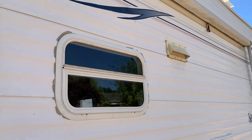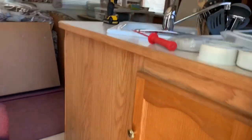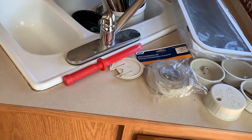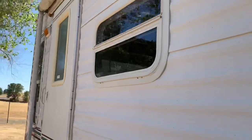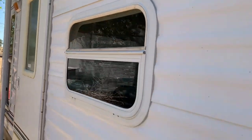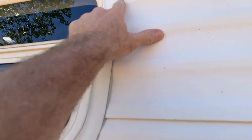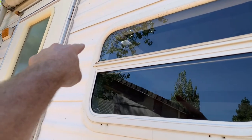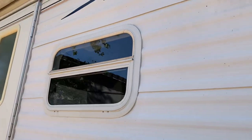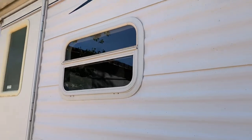You can see a bunch of butyl tape squeezed out there — I'll clean all that up with my Teflon stick and make sure there are no gaps in the butyl tape. There it is — fresh pliable butyl tape, no gaps. What I like to do is go from about right here all the way up and around with Lexel clear sealant, so the brunt of the water coming down off the siding has a bit of sealant flashing to push it away off to the sides.